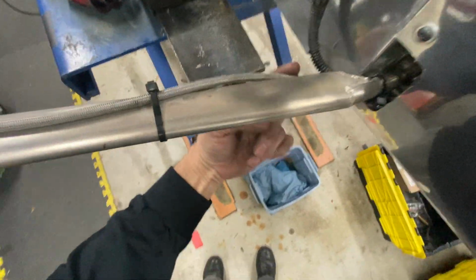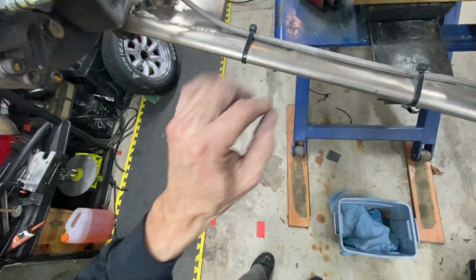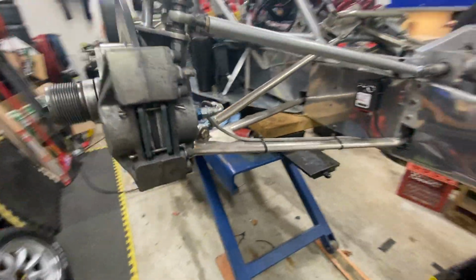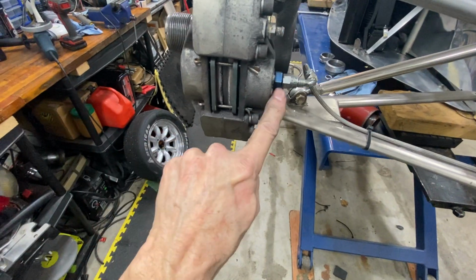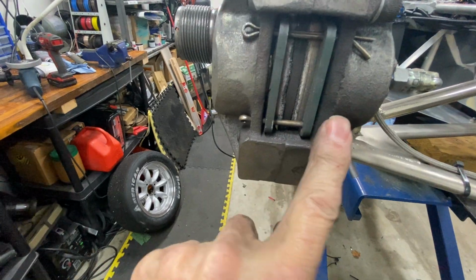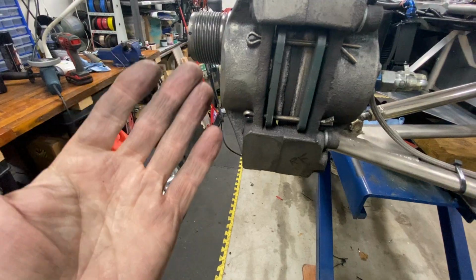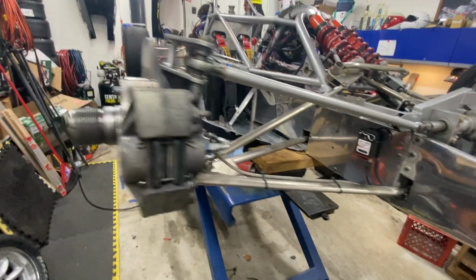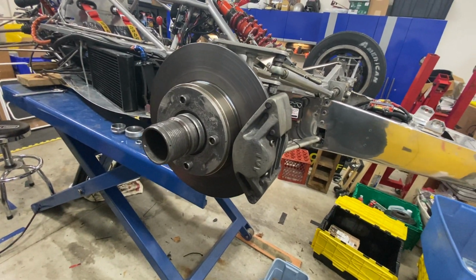Okay, so right front suspension, there's a brake line coming out, tie wrapped to the lower control arm, comes up and into the caliper. This car, these calipers are custom made for the car. Piston here, brake pads in the middle. These cotter pins are holding the brake pads in so they can be very quickly slid out and new pads put in. I go through 2 sets of brake pads every season, and way too much money for brake pads for what they are.